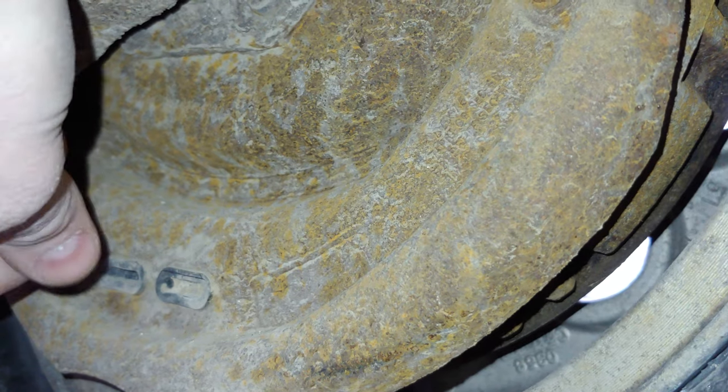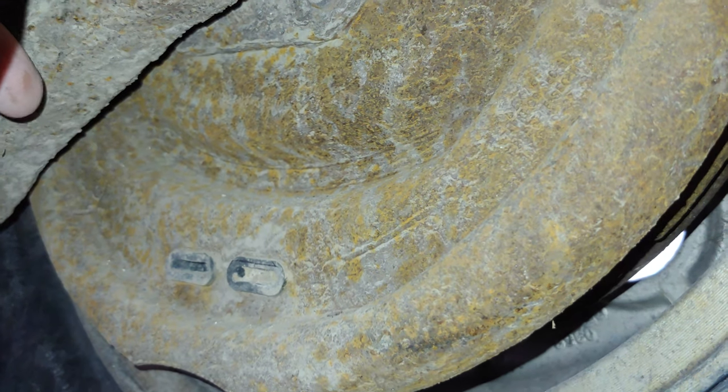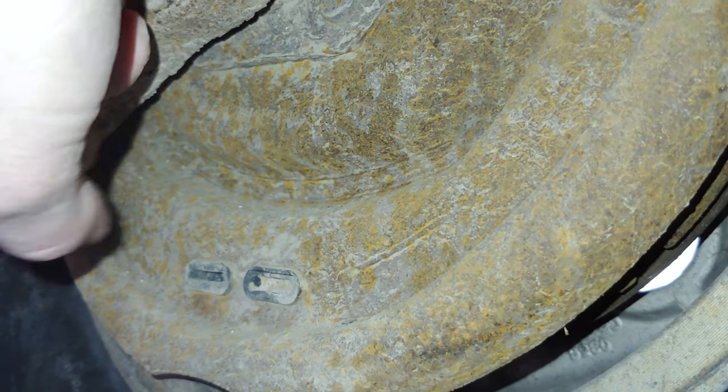They said that these two slots right here — which fortunately I'm not even going to bother taking out because they're working — but you would pop these out and there's an actual tool for it. They said you can also use a flathead screwdriver and just screw the little post in. What that does is separate the drum brakes — these are obviously drum brakes — and put a little bit of tension on them. Or if they're too tight, you would unscrew it. It brings the two pads closer together because the pads run on the outside like this, there's a pivot point at the top, and when activated they just get pushed apart against the inside of the brake drum. But that's how you would adjust them, and obviously I don't need to — they seem like they're in pretty good order.